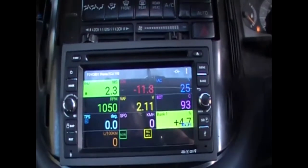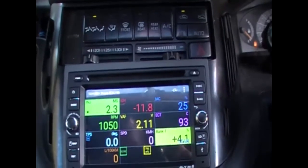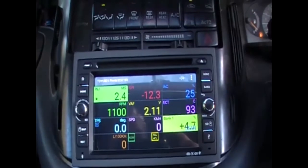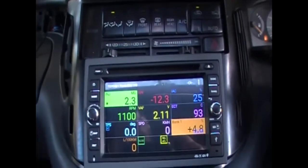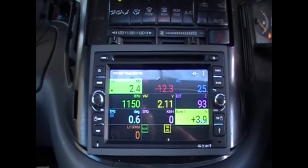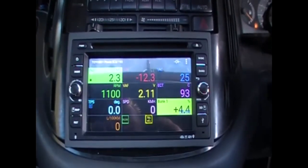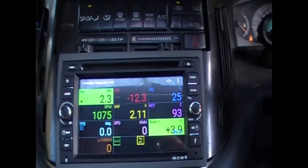My van always had a sound while idling — and you'd probably hear it in previous videos — it always had that running fine but with an occasional miss-type sound. That sound is gone now. So it definitely needed the timing done a long time ago. I'll connect up my power fans now so the temperature cools down. RPM is a bit high with the jumper off, so we'll bring that idle down.